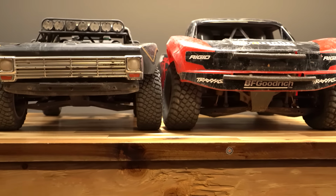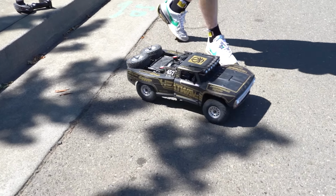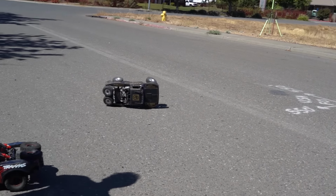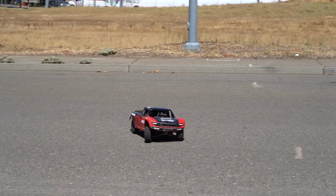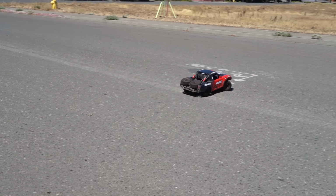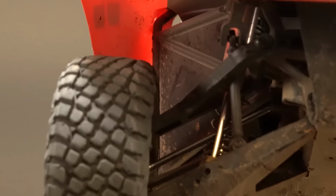The ride height on the BR2 also sits higher relative to the UDR, so it's like half sprung and you get more body roll and rocking back and forth when you brake or accelerate, and you traction roll more easily. The UDR rocks around too, but it doesn't seem as dramatic since it's so low in the suspension and it traction rolls less.